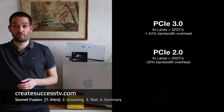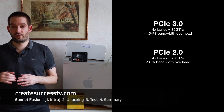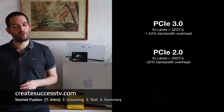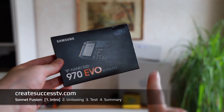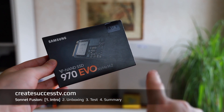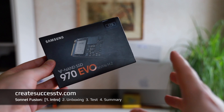Up at the top you can see the data rate of four lanes of PCIe 3.0 — that's basically what the NVMe should be capable of from a PCIe 3.0 standpoint. PCIe 2.0 has a different encoding — I think it's an 8b/10b encoding — so if you have 20 giga-transfers on PCIe 2.0 you actually have to subtract 20%. That perfectly explains why using this NVMe with a normal adapter card limits you to a maximum of around 1600 megabytes per second.